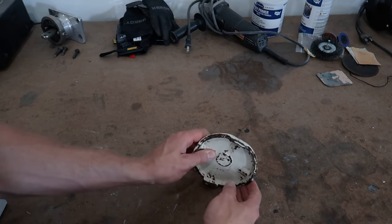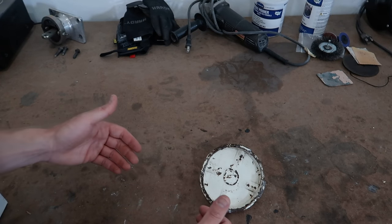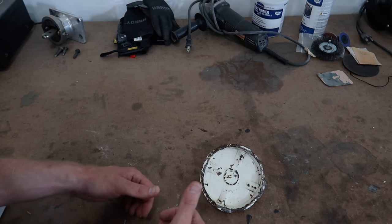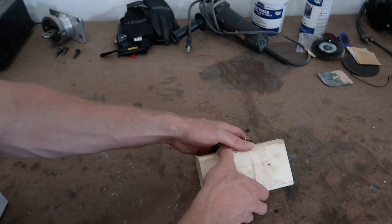Number four: the jack pad, at least mine, has teeth on it. When you're using wood like two by fours, depending on how you use it, it could have a tendency to split. You can see the teeth on my jack pad and things don't sit flat in there. For this job I generally use two by fours, but I prefer using four by fours or four by sixes because it's very unlikely they'll split. If you've got some four by fours laying around, prefer those over two by fours.